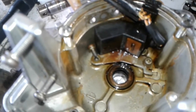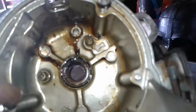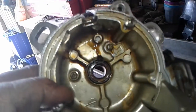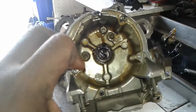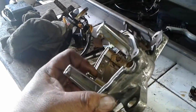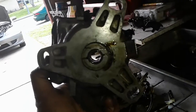Take the magnetic pickup coil the rest of the way out along with the rubber plug, so you can see what the housing looks like on its own. Now it's just the housing — you can see it's really wet and that seal was not holding at all. Oil leaking in stops electrical current from flowing to your ignition system, preventing your spark plugs from firing. You'll get a misfire — or for older cars you'll feel a misfire — and eventually it just won't run because it's so saturated. Electricity cannot travel through oil like it can through water.